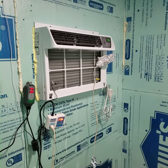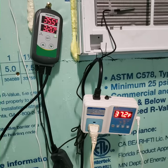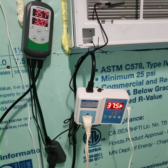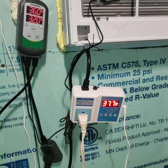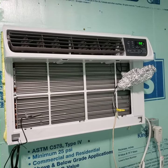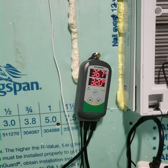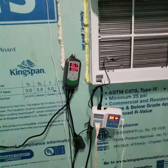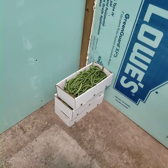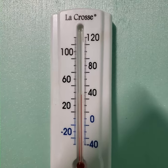The lowest we had it was too cold — down to 32 degrees in here — so now we're just working on dialing it in and getting the right temperature. You can see since it's turned off it's going back up a little bit, 37.4. When that hits its high temperature it's gonna turn the light bulb back on, the air conditioner is gonna think it's warmer in here and start blowing cold air again, keep blowing cold air until it hits its low temperature or until it gets ice. This worked out pretty good — we're still testing it. I've got some green beans in here so far, but right there keeping it below 40 degrees.